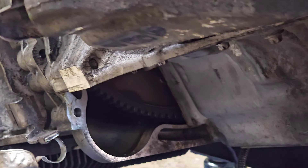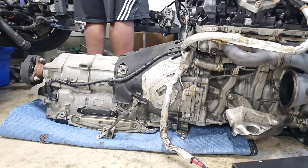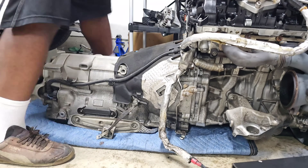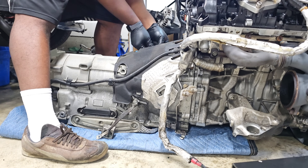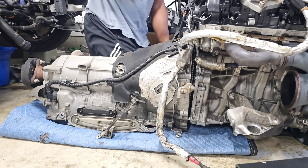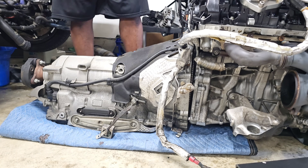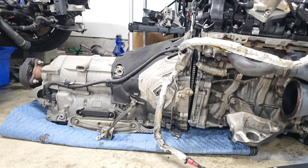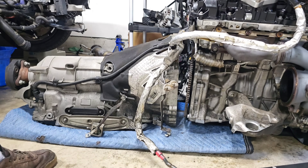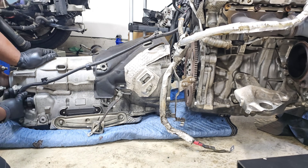I'm doing everything with the engine on the engine hoist, so it isn't the easiest, but it worked in a pinch. Now we're going to remove the transmission bolts. They're in different lengths and in a very specific orientation, so you need to pay attention to where they are or what holes they're coming out of. I like to lay them out in the correct orientation so I can remember where they go when it's time to reinstall. Generally speaking, the longer ones are at the top and the shorter ones are at the bottom. With all the bolts removed, we can pull off the transmission. It may need some motivation, so just take your time and make sure you pull it straight out to avoid damaging anything. Don't forget to unplug the connector at the back — it has a tab that rotates and then just pushes the connector out to release it from the transmission.